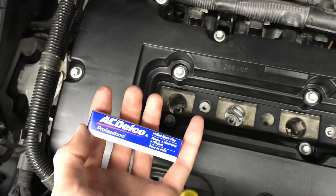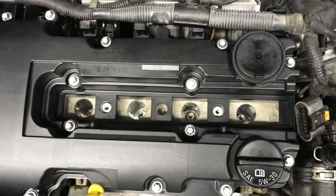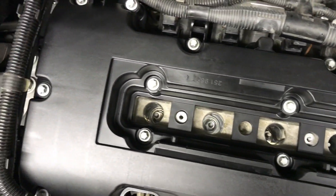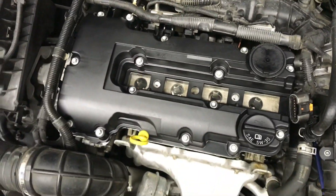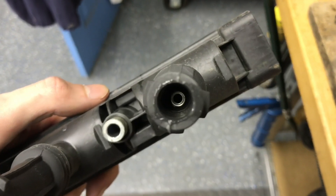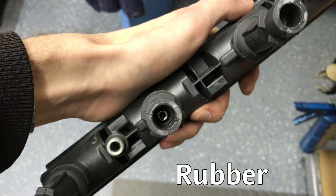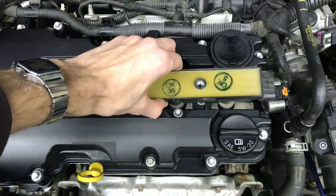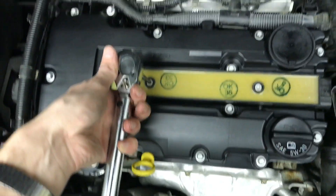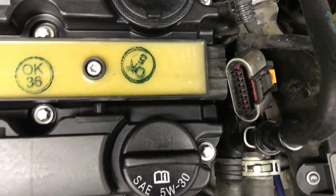Since I'm here I'm going to do my spark plugs because of my mileage — see what yours is at and decide for yourself. There will be a link in the description for my video on how to do the spark plugs. Go ahead and put a little bit of dielectric grease inside the boots, and also make sure that each spring is facing out and not hung up on the plastic because it might fold in when you install the coil pack. Guide your coil pack in and push it straight until it stops. Use that T30 and torque those down to 71 inch pounds. Go ahead and reconnect that wire and make sure the plastic clip clips in.